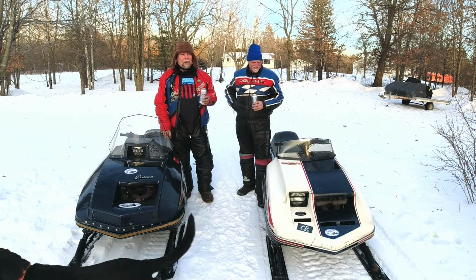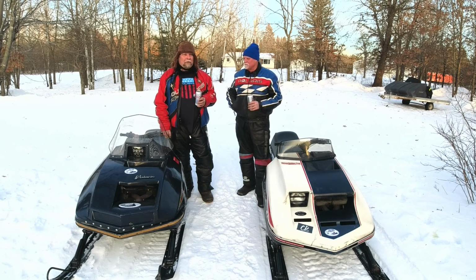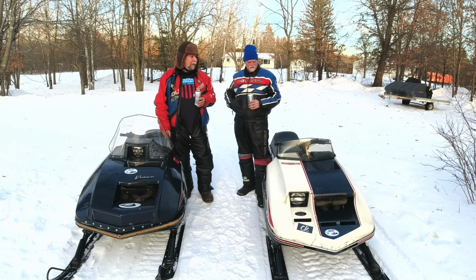Our next ride we're anticipating is going to be the Thursday vintage ride up at Bratfest, which, according to the current weather reports, is going to be between -5 and -8 Fahrenheit. So one jet richer than stock isn't going to hurt us on that day. We had some hard starting issues with it, and it has 35 jets in the pilots, and we may go back to 30s.